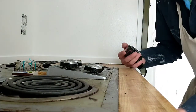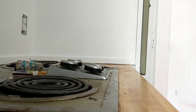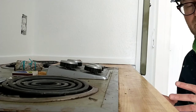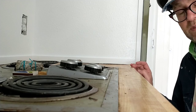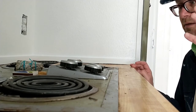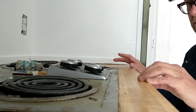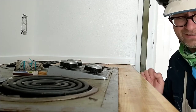I'm going to have to see what the hole is like underneath, and then see what kind of hole requirements the cooktop has. Then I'll need to open up the cooktop — apparently in shipping, the magnets often get displaced in this particular cooktop. I'll need to open it up, get those magnets in place, take the old one out, put the new one in, or enlarge the hole if I have to, then wire it up. Should be no problem — though I don't think I'll finish all that today.